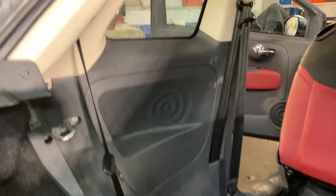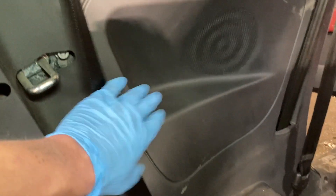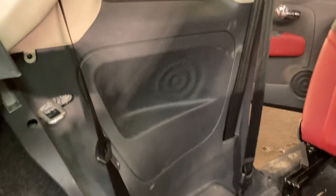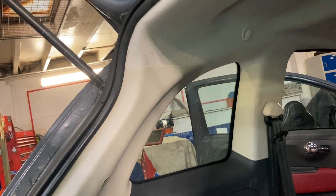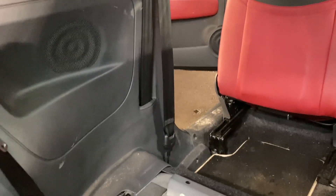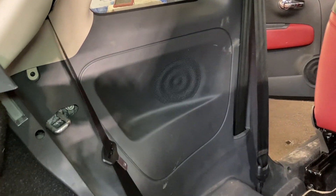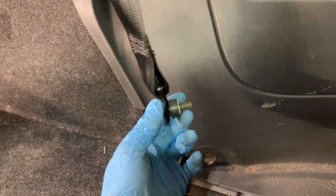With the bench out, we have a full view of the panel. The Blue and Me is right behind here. It looks like you can take that panel out — really annoyingly, you can't. That is one solid object. So now we're going to be looking around here. This trim here we're going to pop down a little bit, and where the seatbelt joins we're going to remove a bunch of different things so we can get this trim out of the way. A lot of little bits of work, pretty annoying, but it is doable.